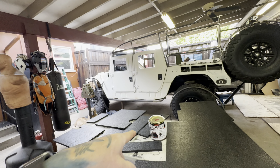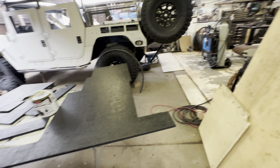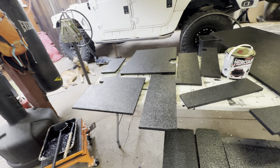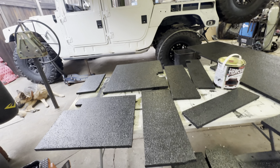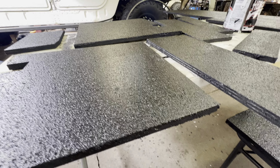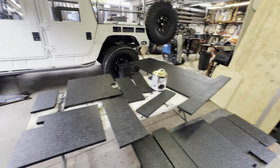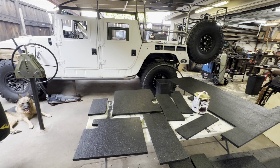I know I'm going to need another can. This is the birch plywood that started off just plain. Before the rain comes in the next couple of days and all that moisture in the air, I just wanted to get it treated. I run one coat around the edge and then do the tops. I'm looking for a uniform, matte finish. There's a glob right there that I need to work on. Once you get this laid out, this is about an hour in — I've got one side covered and all of the perimeter.